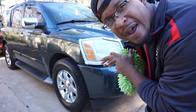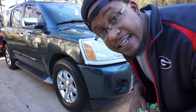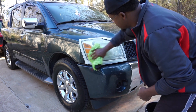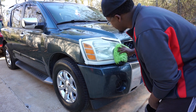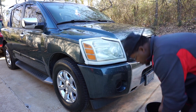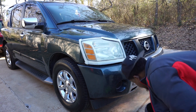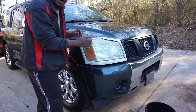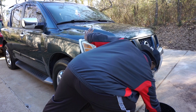All right gang, we're gonna start out with 800 grit. I know this headlight ain't too bad but it is kind of yellow and the light is going away, so we gotta go ahead and get this done. Make sure you wet down the surface — you can get a spray bottle, it don't matter — just make sure you keep it wet. What you're doing is wet sanding off all the oxidation. We're gonna go this way, then the next pass up and down, just keep alternating the sanding direction.